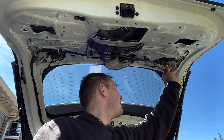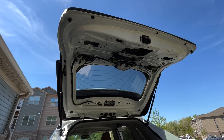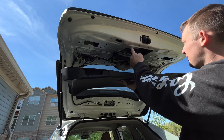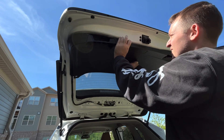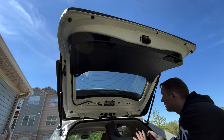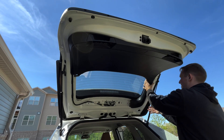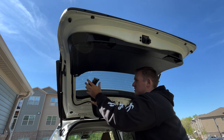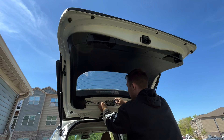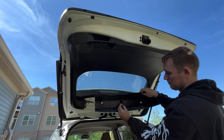Then just plug in your wiring to the new bulb housing, then test it out to make sure it works. The way you put this back on is exactly the way you took it off. Find these first two push pins — which are probably right here and right here — line those up, stab those in, and then go around. Just like that. Then grab the first side piece, go around this lip, swing it around this plastic trim. Same with this side, and then this one.